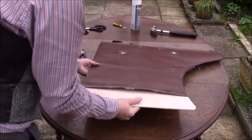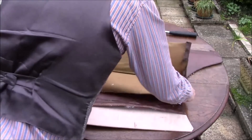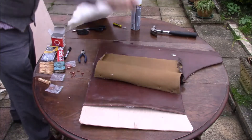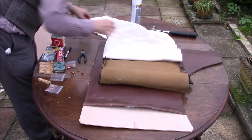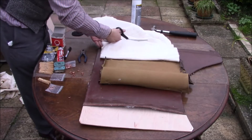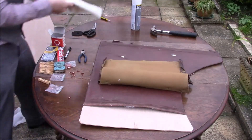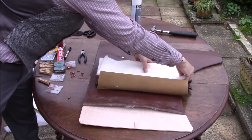It did take quite a while — this is sped up quite a bit. Doing this with a staple gun it would have gone a lot quicker, and having a proper tack hammer would have probably helped as well. The tacks have a very, very tiny point on them, so you can actually push them in like a thumbtack, and they hold themselves in place usually — then you can just knock them home with a hammer. With all the ones tacked in, the top edge isn't tacked, that's actually glued. So our next piece is the pocket. You need a bit more cotton wadding because you do have a double layer that goes inside the pocket piece — this is actually held in just with the shape of everything, so it's very easy to install. The cotton wool basically sticks to itself and sticks to the back of the fabric, a bit like fuzzy felt really.